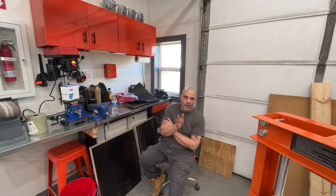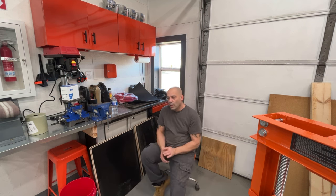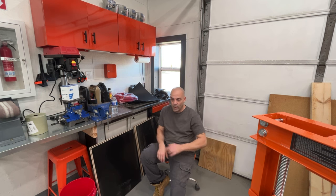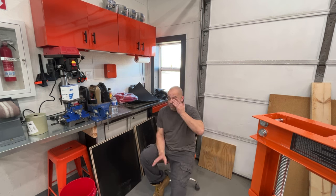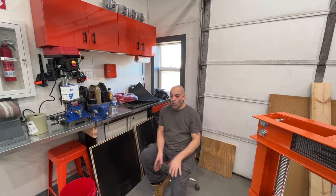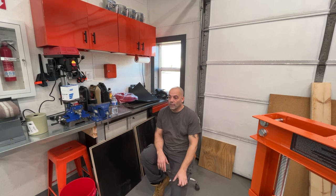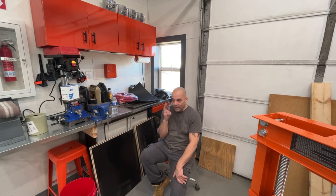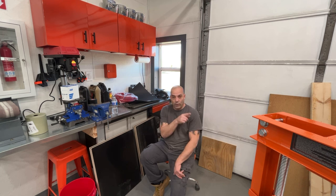They're putting the hydraulics back on the car, but originally when the car was done - probably 25 to 30 years ago - they didn't have one-piece floor pans back then. You had your right side, your left side, all individual pieces. Since it's a convertible, we're going to cut the whole floor out and drop in one whole new floor pan as one piece. We'll sandblast underneath it, drop in a whole new floor pan, strip the whole body down, redo the whole body, and get it ready so he can roll his new frame underneath it. That's coming towards the end of April.